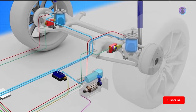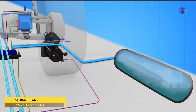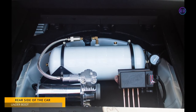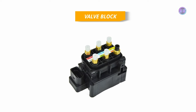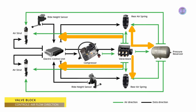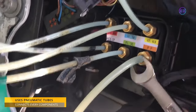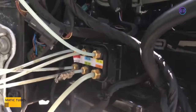This compressor compresses air and sends it to the storage tank, which is mounted on the frame behind the front wheels or located under the boot area. The second main component is the valve block, which is located alongside the compressor. This valve block controls the direction of airflow inside the system, using air tubes to connect every component such as the compressor, storage tank, and air springs.